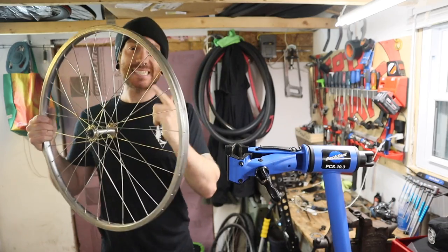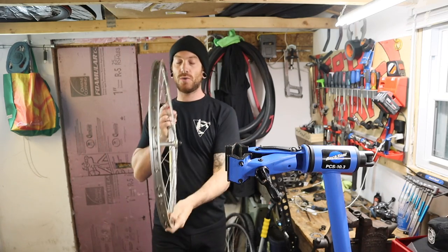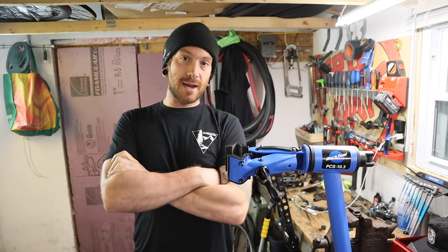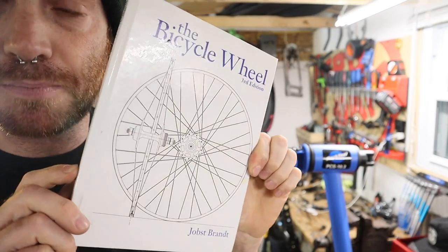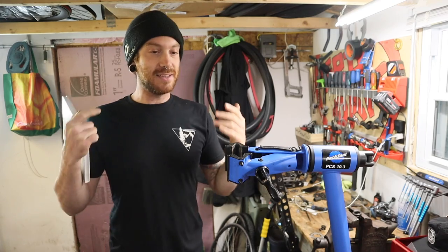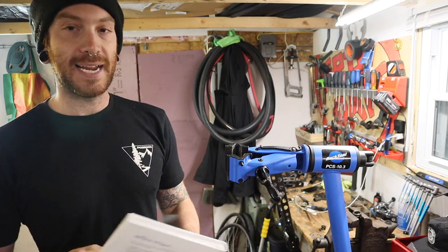You just laced a wheel — how long did that take? The next step for getting your wheel done is bringing up tension, then truing radially and laterally until you're at the tension you want with the wheel as true and straight as you can get it. I'm not going to show you how to do that — you should read this book. If wheel building interests you, check out the Sheldon Brown link below, and I'll also throw in the wheel hub spoke length calculator database, because it's a really handy tool.